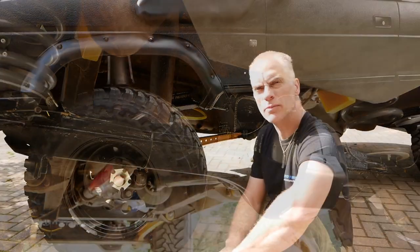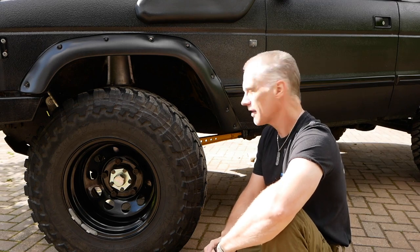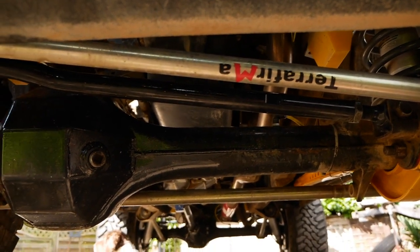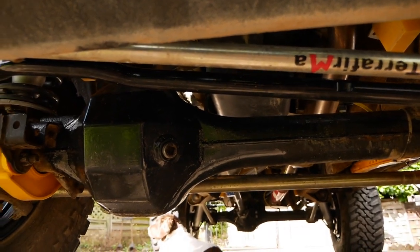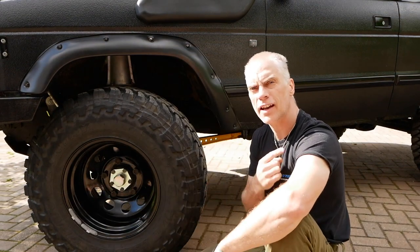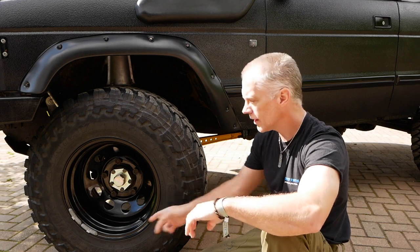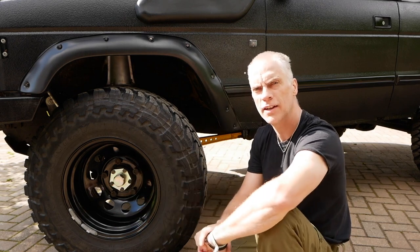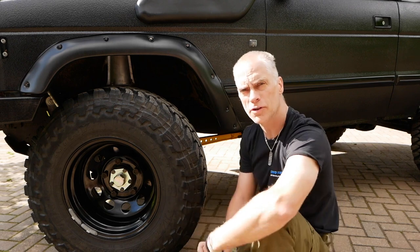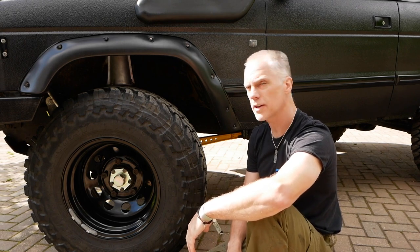The axles are actually heavy duty cases that I've built — there are armored pans on the pumpkin front, they're all reinforced with heavy-duty flanges. I still need to do the rear one because with the locker in the rear I need to put in the heavy-duty drive shafts and heavy-duty drive flanges, but it's all money so I've got to earn some more pennies to do that. That's another video. For suspension, go check the videos out — I've done more than enough videos on suspension.